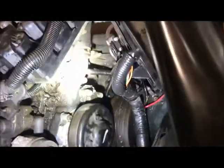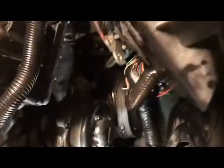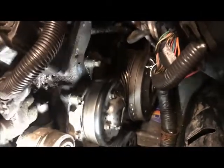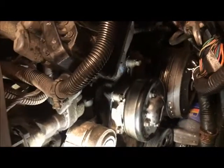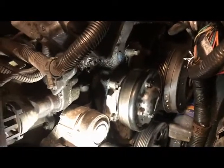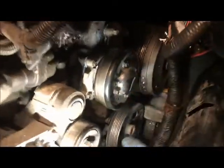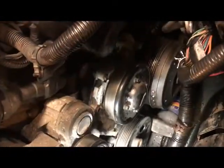We do not have to take out the radiator hose. The pump is right there — you can see the blue silicone from before. The new pump has its own gasket, so I don't think you need to put silicone on it; maybe that is why it was leaking. We have 10mm bolts and a couple of 13mm ones — there is one 13mm down below.